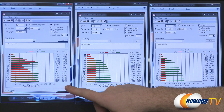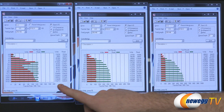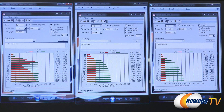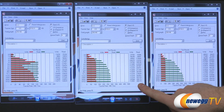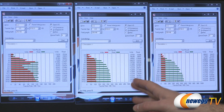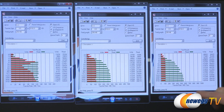On this test we saw similar results to CrystalDiskMark. Maximum read with no SSD attached was about 128 megabytes per second, and about 116 megabytes per second was the fastest write speed. Moving to the SATA Revision 2 connection, we hit up to about 283 to 286 megabytes per second on the read, while writes stayed pretty constant at about 112 megabytes per second — because it's writing both to the SSD and the mechanical hard drive when copying data for the first time. On the SATA Revision 3, 6 gigabit per second test, we hit some very high numbers: 554 megabytes per second was the max on the read, comparable to the Crucial M4, which makes sense since they use the same controller and NAND chips. Writes were again all about 112 megabytes per second overall.